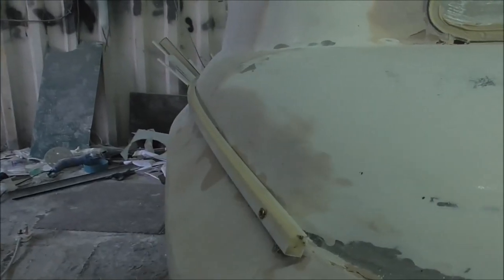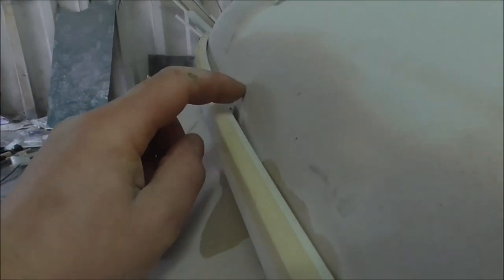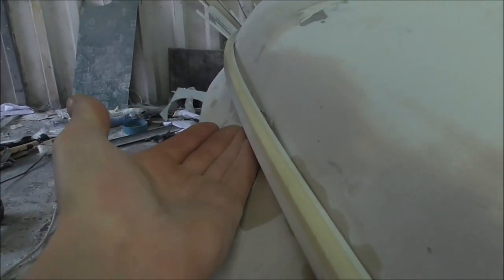If we look at this piece of plastic, we can see there's quite a gap behind it. Huge gap there. That is quite a nice line, that really subtle bow to it. So just like I did the other week on the rear fender, I'm going to backfill down here with filler, and that will give me this nice curve. But I'm also going to fill underneath, and that will give me the continuation of this swage line,